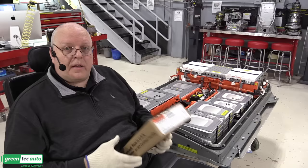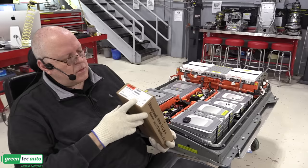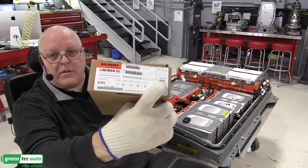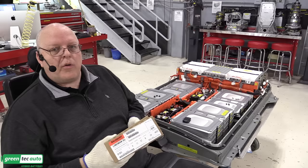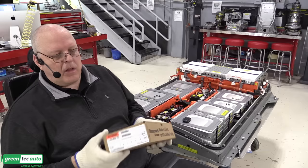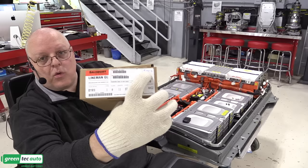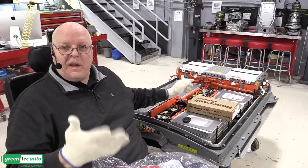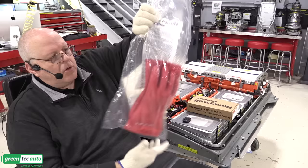With the leather outer covering. This box of gloves I purchased earlier this year, it has a 5 of 19 date on it, and this is 12 of 19. And if you've heard there's a 6-month expiration, that's true, but it's only from the day that you opened them and first used them. So we actually received them on 8/29 of 19. And according to OSHA, they can sit unused in their box for up to 1 year before opening them, and then you still have 6 months after that. So these are brand new